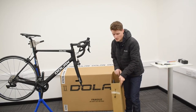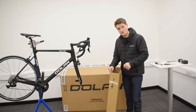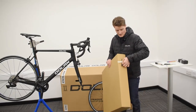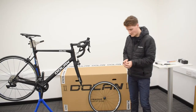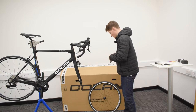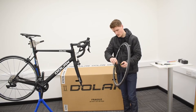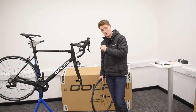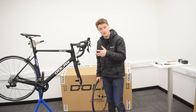Now, to attach your front wheel, what you're going to need to do is take the quick release — which will still be sellotaped to this part of the box at this point — and pop it into your front wheel so we can then attach it to the bike. Untape this here — nice and simple. Make sure you take the end cap and the spring off, then fit the quick release through the wheel hub, put the spring on, and put the end cap on. When it comes to fitting it to the bike, it's important to ensure the switch and your front brake caliper is all the way open so that your brakes are as wide as possible so your front wheel can fit in much easier.